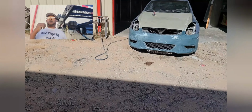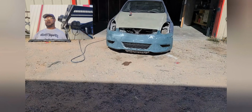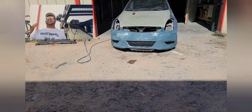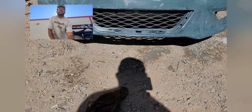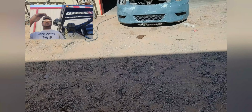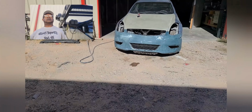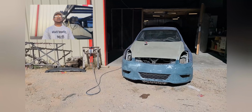Alright guys, so now all the sanding is done. I'm gonna put putty on two areas. Front left fender needs little spot filled. Rear bumper where I sanded the Bondo, that needs to be filled. And I think that is for putty. And I'm gonna go ahead and take the front bumper off, DA down the foam. Because if you can see where the bumper is pretty much sticking up in front, right there. You gotta take that foam down about another half inch, so it'll bring the bumper down and hopefully level everything out. So the front split on there also. All right, let me set you guys up, knock this out, and see what else we can do. I was hoping those two guys would be here to throw a primer, but they're not. So, we get back to work.